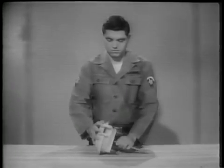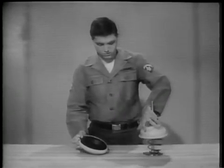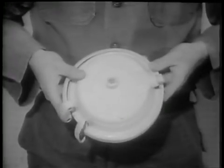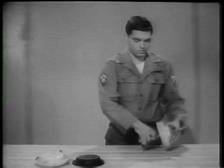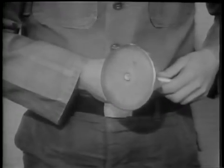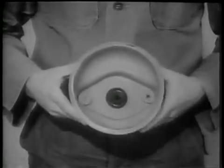This brake chamber is the air-applied, spring-released type. Disassembled, it consists of the following components: the end cover and retaining ring, the flexible rubber diaphragm, the piston or plate, and push rod. The piston release spring, the main body and mounting point.